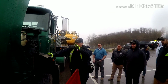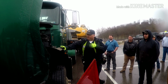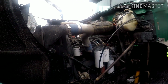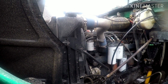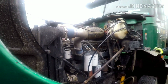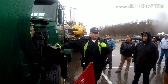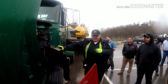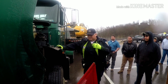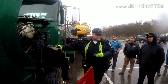So, all right. We done all that. Obviously you guys are checking your fluids, doing all that stuff. But what we're really looking for, as far as DOT side, is the fuel rail. Depending on whatever side, some of the other motors are, but basically checking those components out. Common stuff like lights, yes, you want to check each and every day, but some of these other areas, really getting down, looking at your brakes, brake chambers, airlines, that's not necessarily something that has to be done each and every time, but at least once a week, really slow down, really go through that, really check that stuff out.